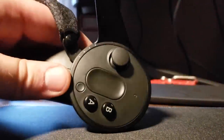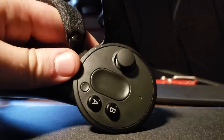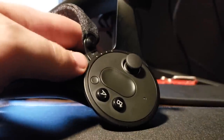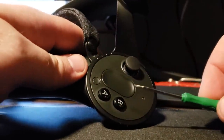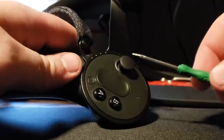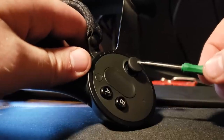I'm going to show you how to repair the click of your joystick. I think this is the only method I know that works. What you need is a small pry tool and a soldering iron with some solder to add a little bit of metal on the end of the metal joystick rod that's underneath the cap.